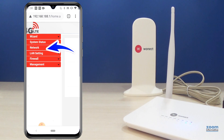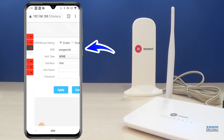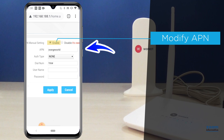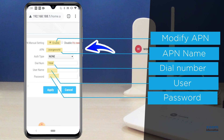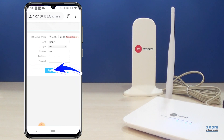On the left, select Network and APN. The APN configuration will appear in the center, and although this example is for our operator, you can modify it for the operator of your SIM card. Check this box to be able to modify the APN data manually. Write the name of the APN, telephone number for internet access, username and password provided by your internet operator to configure the APN. Click on Apply Changes.